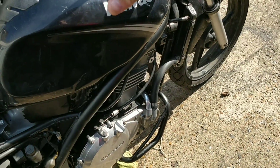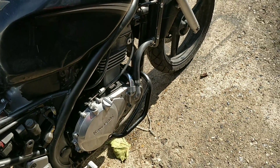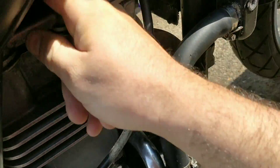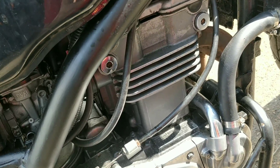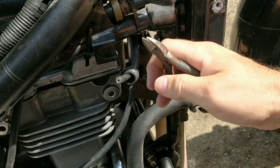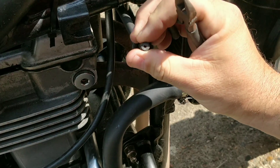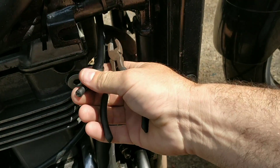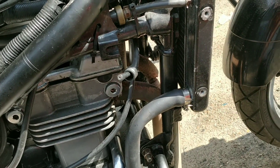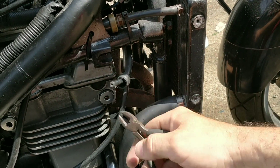Let me get under there. The tank's loose — I should be able to turn it sideways without unplugging anything, or just bulk it up a touch, and see what we're working with. Something may have simply come loose. I'll check the wires on the coil and go from there. When you've heard me say in the past 'chop the coil wire a touch' — this is what I mean. You chop it a touch because there are threads in there that the end of the cap screws into, and they just get a bit dirty and crushed. So if you cut a little bit off — obviously it still has to reach its destination — you'll get a better connection. It's always good to do that with a bike that's been sitting a while. In the end it gets too short, but that's how you get many years out of it by just snipping a little bit at a time.